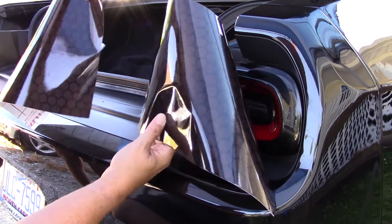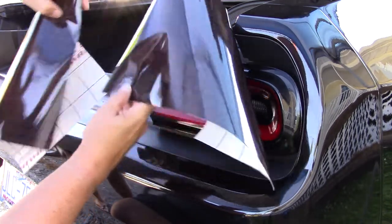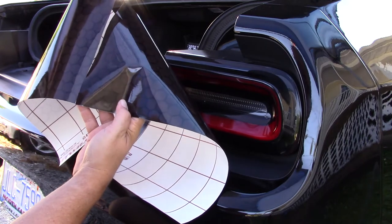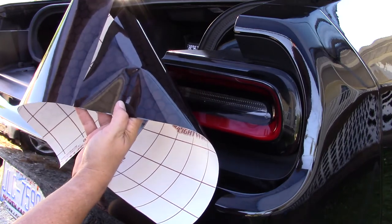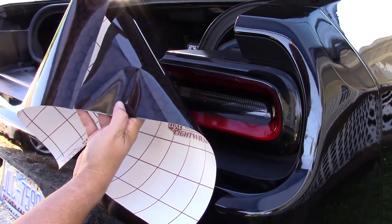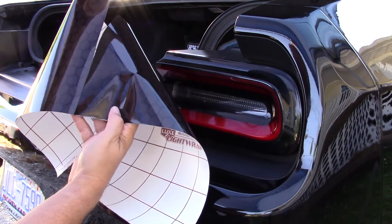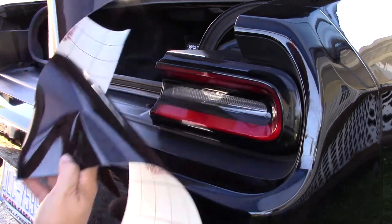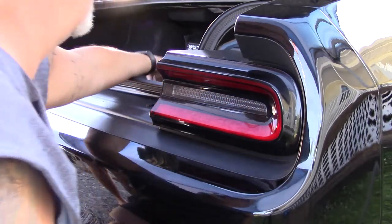I have a question. Whenever you do this next one, I'm going to start with my honeycomb at the bottom. And when you do the next one, you want the pattern to line up as much as possible, to where you don't have one like this and then one like this. You want the pattern to be as lined up horizontally as you possibly can.